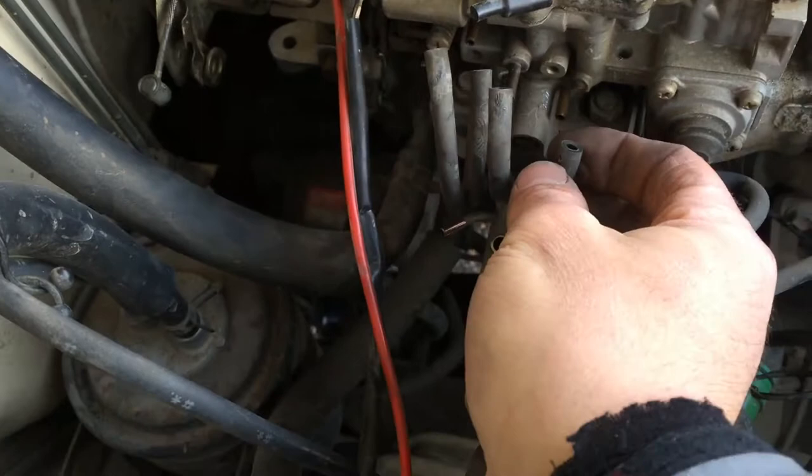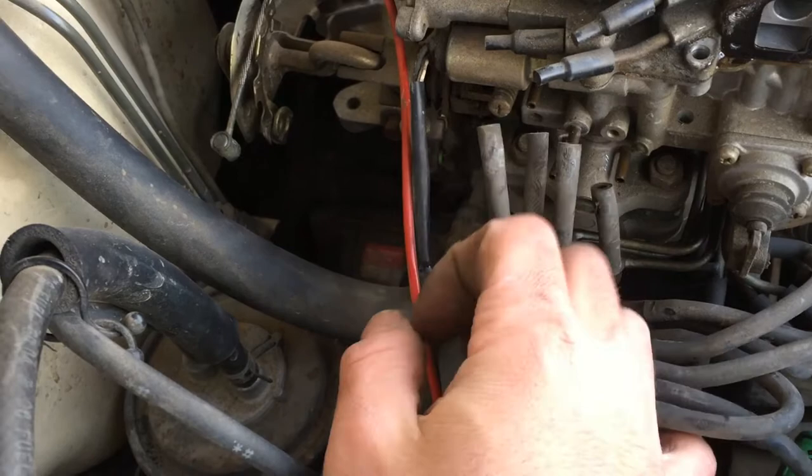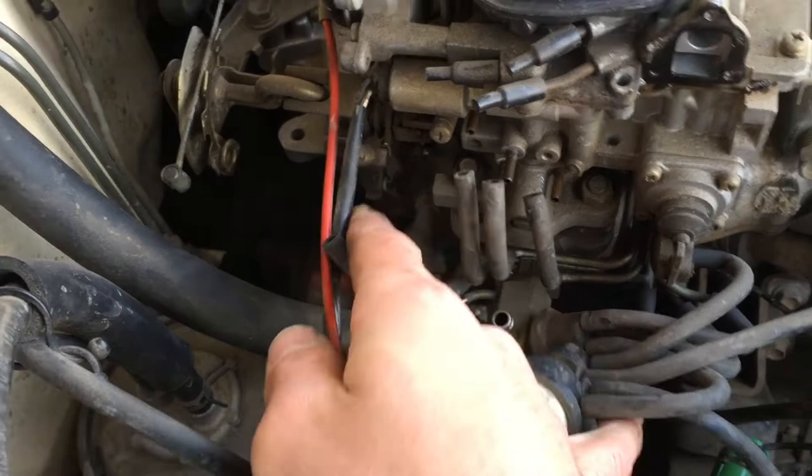Either way, these things are 37 years old, so they need to be replaced. Don't expect to do this carburetor rebuild without just accepting that you're going to replace your 40-year-old vacuum lines. They're 20 years beyond their service life. If you're doing it this far, you should replace your vacuum lines, otherwise you're going to start leaks.